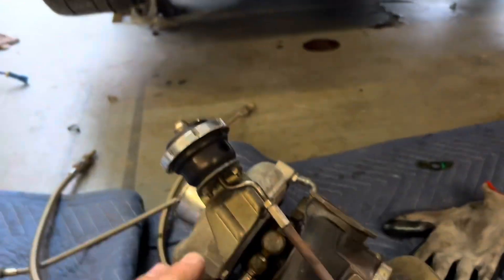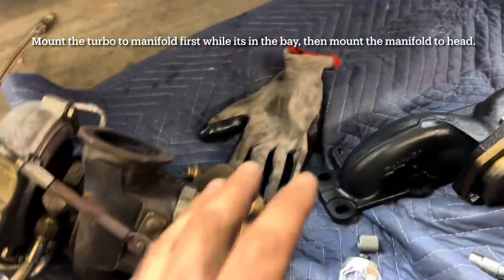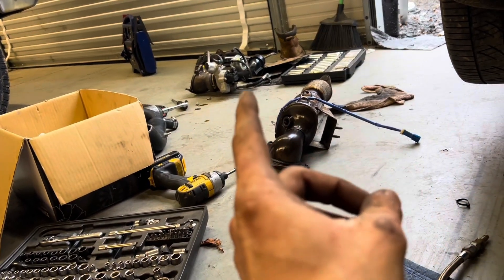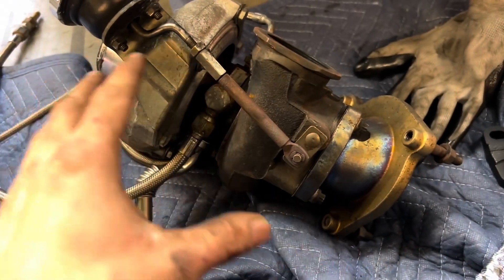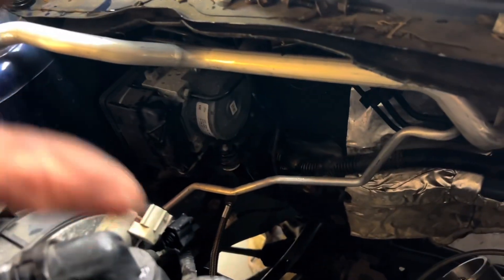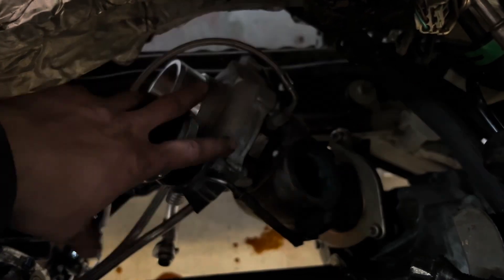What I'm going to do is place the turbo in there, have it sitting on the subframe, then mount the manifold up, and then bring the turbo up and mount it with the V-band. That way I'm not trying to shove a huge assembly in — and that one was already a pain to get out. I've done it this way before and it's a lot easier. The turbo is sitting on the left-hand side of the engine with the bigger gap, and now I can bolt on the manifold and from underneath put it in place.